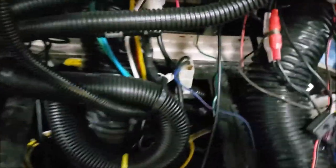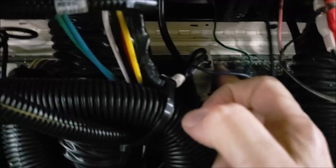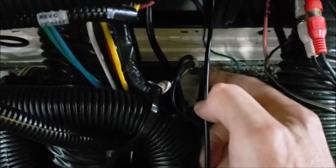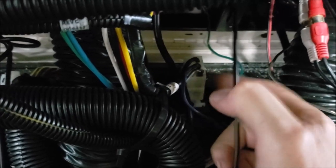That's almost 140 degrees this little connector is. That's the problem. I believe this powers my blower motor. But it wouldn't take much more — it could be a real issue. Let me get a little light on it.